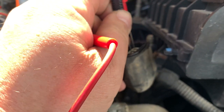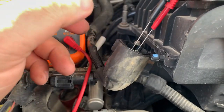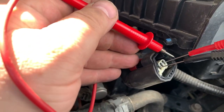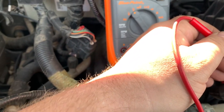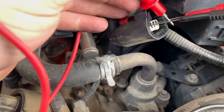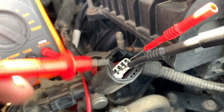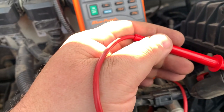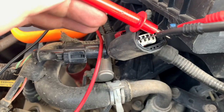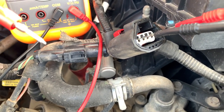Now I'm going to take this wire out and plug it into the next pin. They want you to test resistance going down that path, but if I touch right there I get a volts reading — so I know there's no short in that wire. Then moving over to the outside pin, touching there, I also get a volt reading. If you didn't get a volt reading with the key on, engine off, while probing both of those, you have a short in your wiring harness somewhere.